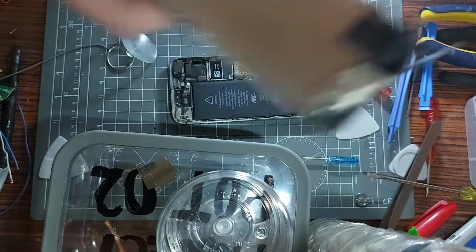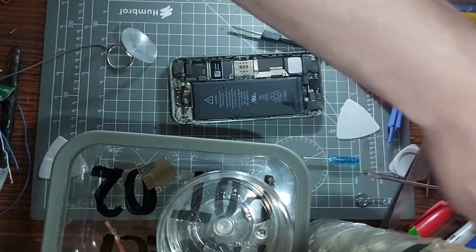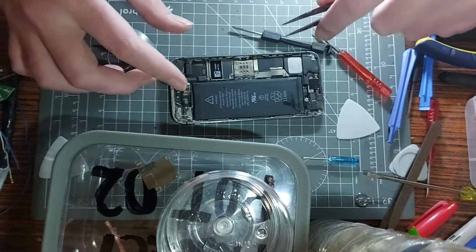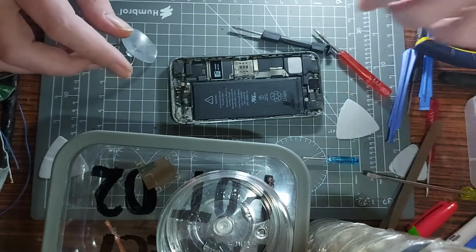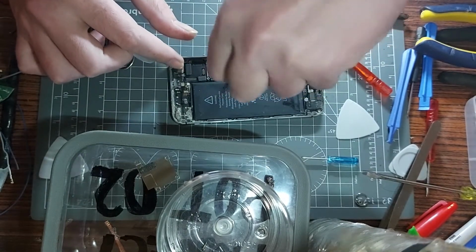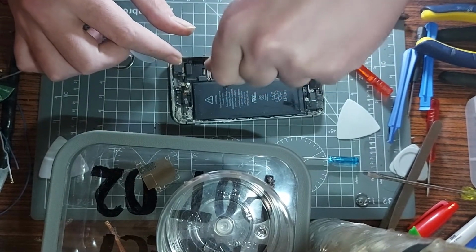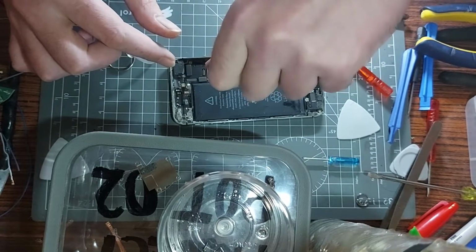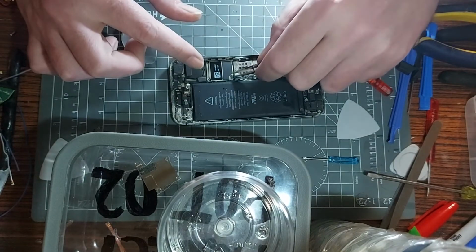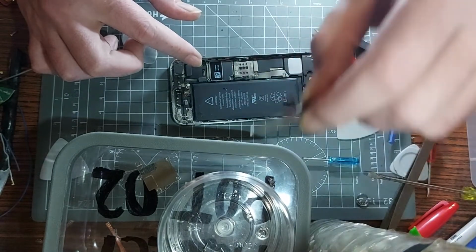Like I said, if you've seen my previous video, you'll know what I'm talking about, so we will come back to that at some point. Alright, so where we're going in, and let's go further. To remove the motherboard, we're taking 4 screws out of this internal bit and 2 screws from the bit prior to that. You know, the 2 at the bottom next to the charge port.